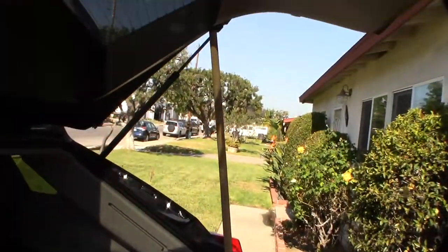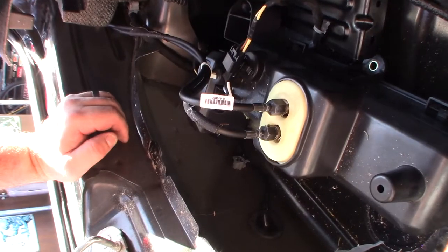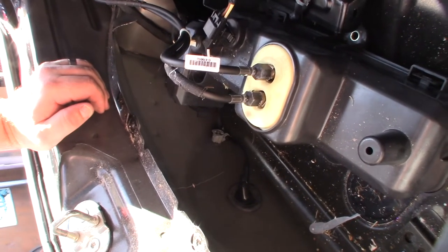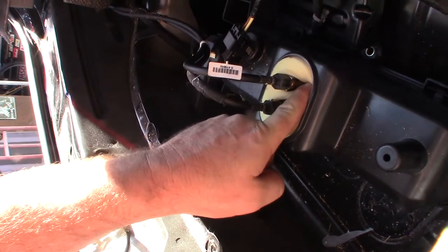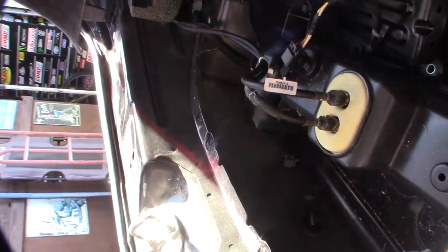Now I have to figure out the path — the hose goes all the way around, as you can see. I need to move this electrical box forward; there's a screw down there to pull it forward. Now that the pump body is loose, I have to take the cables off before I can remove the housing. I'll get my screwdrivers in there and pop these hose fittings off, and I'm going to put some rubber caps on the ends so fluid doesn't drain everywhere.